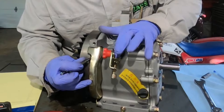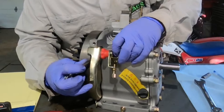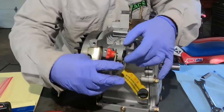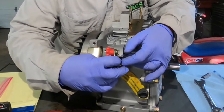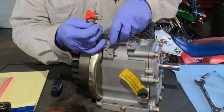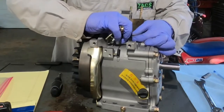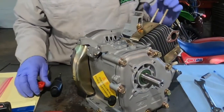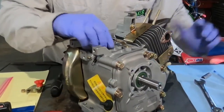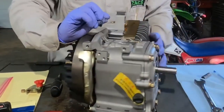I'm just going to use my finger and roll that out. Okay, have that nut off — you can take this thing out now. Those springs, I'll get a little bit closer and show you how they attach. Make sure you make notes. My particular engine is in hole number one right here with the spring. When you reassemble, make a note of that so you know your spring goes back in the same hole.